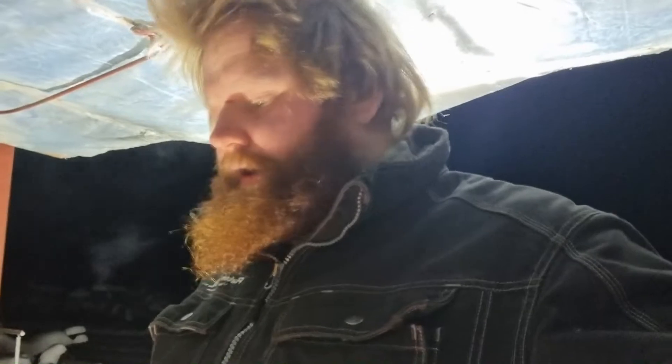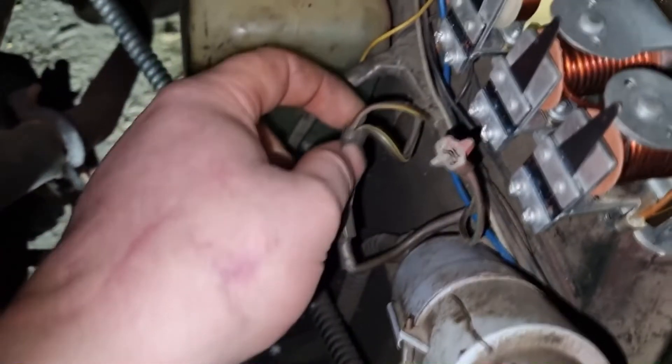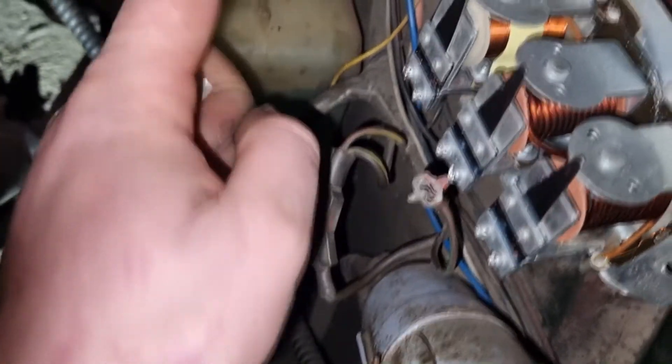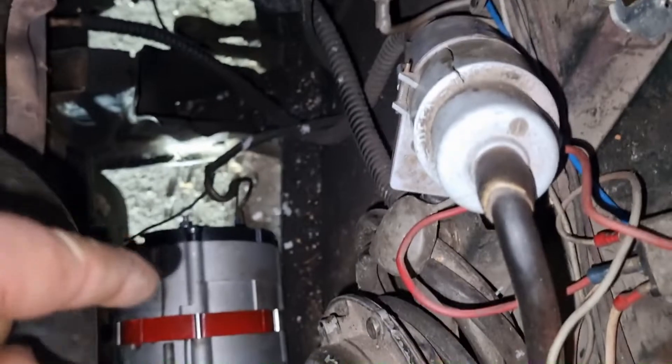All right, so I looked at this a little while and I realized what was wrong. One of the thick leads that goes to the regulator from stock has a thin one, same color, going back into the loom - and that one's the one that goes to the charging lamp. That is why I had to rev it up to get the alternator to magnetize. This is the same issue I had on the Granada where I knew about it. So the two wires that I had hooked together - meant for the charging lamp - well, one of them goes to one of those small relays on the front. This little one right here is the wire I hooked up. In here we have this little brown and yellow one that goes into the loom, into the cabin, into the charging light - so that is the one I have to cut off.